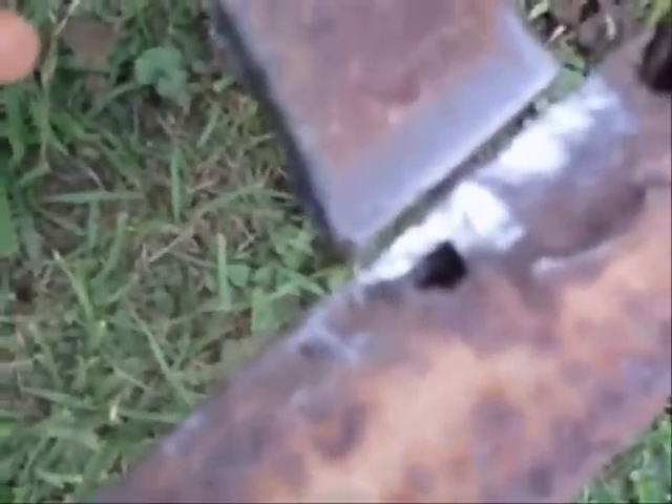I don't have a small piece of angle iron — this is what this is. So what I've done is I found a piece a little bit thicker than what I need, but as long as it works. I've got a little knot right there that I wish wasn't in my way, but I'm going to tack it, and then I'm going to bring it out and stick weld it right there. I've got my MIG and I'll get it tacked and show you what it looks like.